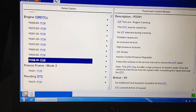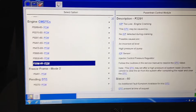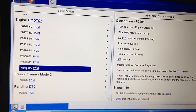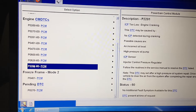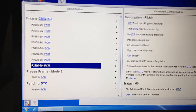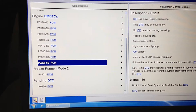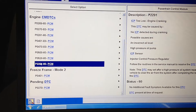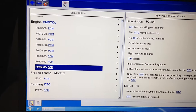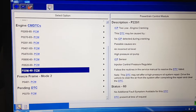This one is the all-too-common crank no start with low ICP. If you have a no start and you have codes for ICP too low, that's what it's seeing during cranking. This one's cold — it usually happens when it's hot. Don't worry about the other codes at all. Concentrate on getting the ICP to the range it has to be to fire, then we can deal with the performance and emissions codes. This ICP code is the one you want to concentrate on for the no start.